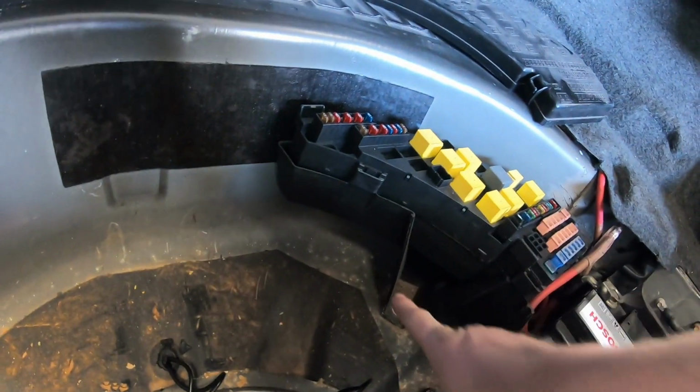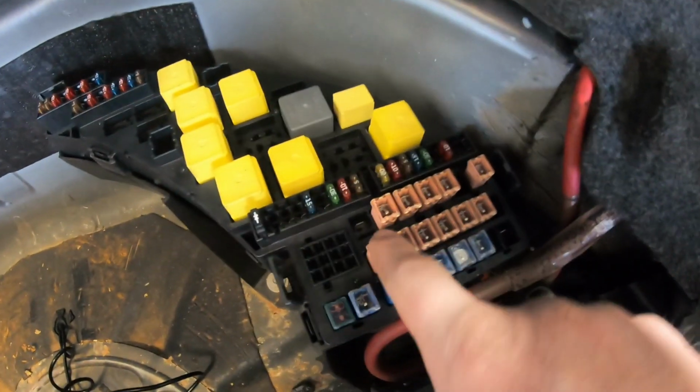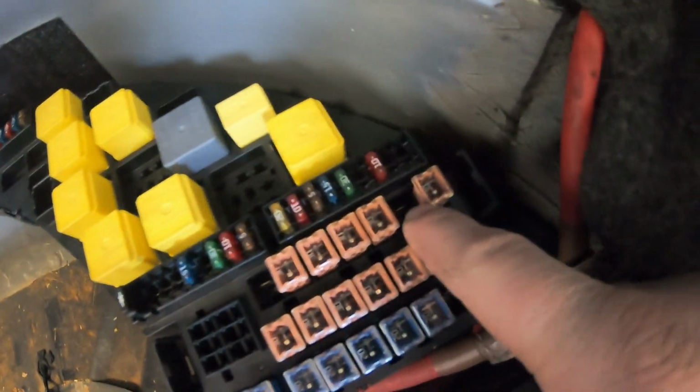There's plenty of space underneath the fuse box, and I've got some spare little spade terminals. I think you can just about make them out there. They've got 12 volts. Just checked that with the multimeter. It shouldn't cause a battery drain. The motors are only turning every time you push the button just to open and close the flaps. So I don't think that will cause any issues.